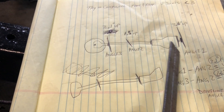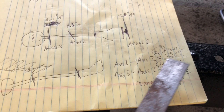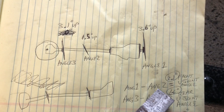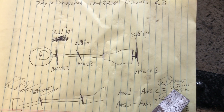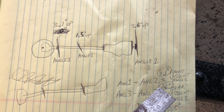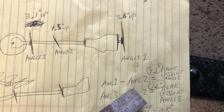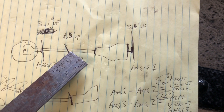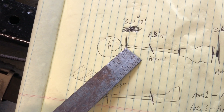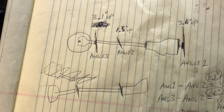What the app does is take these three angles and determine the angle of the u-joint. Angle one minus angle two — which is the driveshaft — gives you the u-joint angle, or at least the travel of that u-joint. The app is trying to achieve three degrees or less of difference between those two angles. The second angle it checks is at the rear u-joint: angle three, taken at that plate, minus angle two, the driveshaft, gives you that rear u-joint travel.